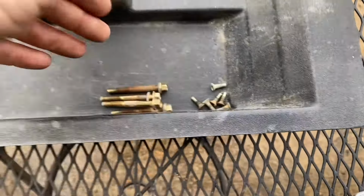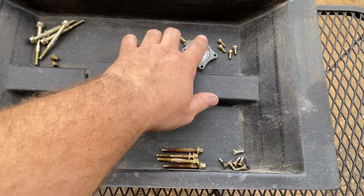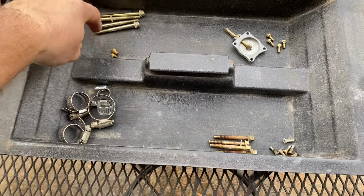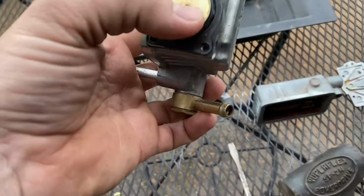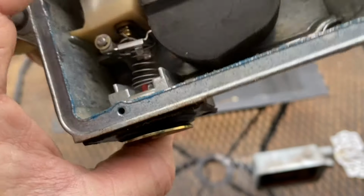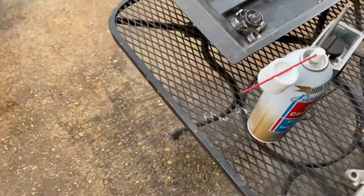That's the screws out of that. And see, I separate everything. This is all rear stuff. This is all front. That's where the booster sets in there for the power valve. This thing, which seems to be in pretty good shape. It's not a very big one. Front bowl's got a little trash in it, not too bad. We can clean all that out. It's got 65 front jets.